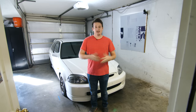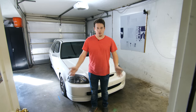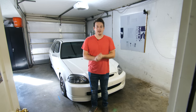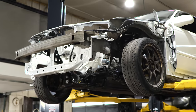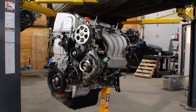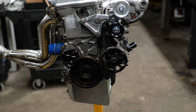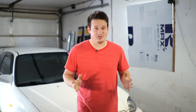If you haven't seen the video, check it out. Everybody's been telling me that I need to K-swap this Civic and that I'd have a lot more fun with more power. I realize that's going to make it a little bit less fun to drive on the street, but I'm okay with that. I've enjoyed it for a year and it's time to move on to something different. So we're going to nearly double the power of this car by putting in a K24 with the K20 head. With the help of K-Tune, we're going to have a ton of bolt-on parts on this car, hopefully making near 260 wheel horsepower. We've got big plans ahead for this little Honda, and it all starts right now.